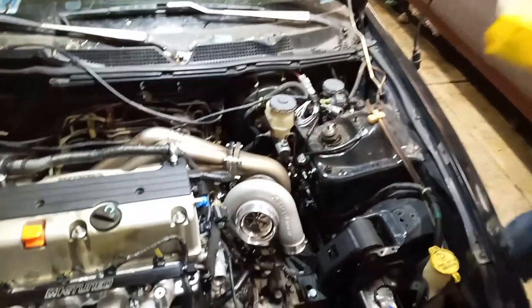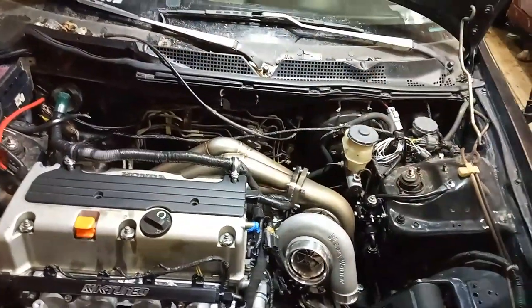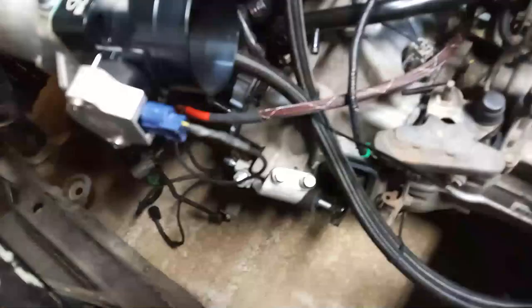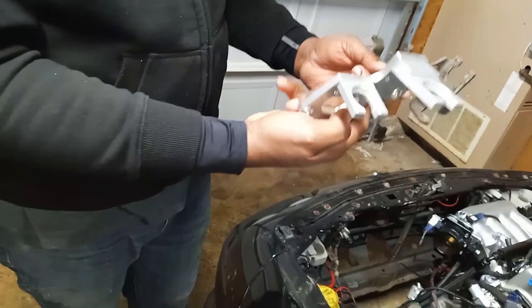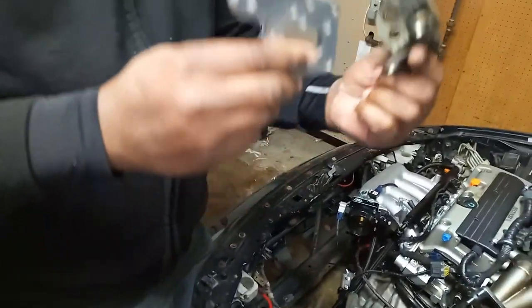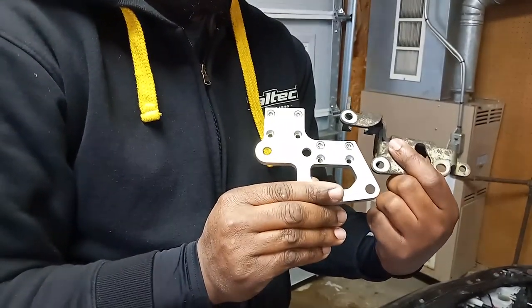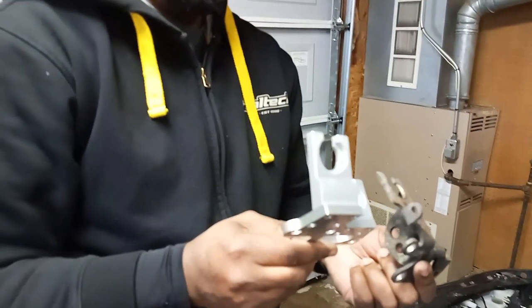The stock clutch line is a hard line that goes all the way over here — it's one of those lines that goes back there. So that's going to shorten that route from right here and come straight down here. We got some new hardware — look at that, it's looking sweet, billet product from K-tune. If you look underneath of it you can actually adjust it — there's two positions you can move it for adjustment of your shift cables, so it's just a little more functionality offered in the product.